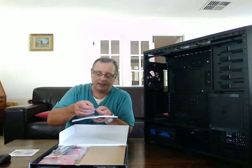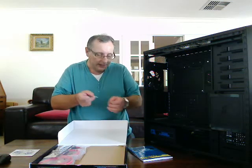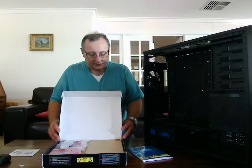There's also a little sticker here telling me that there's an AMI BIOS AE-17-0367 — possibly that's telling me what version of BIOS is installed on the motherboard. One of the things which was important for me to know was that the BIOS would work with the CPUs I'm choosing and also the memory. So I'm pleased that it tells me what version of BIOS is on there, because then I know whether I have to update my BIOS before the actual system will run.